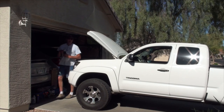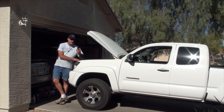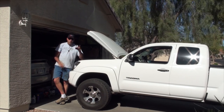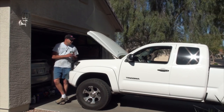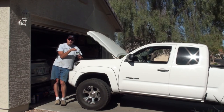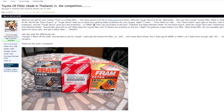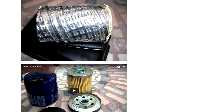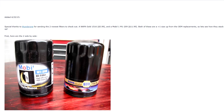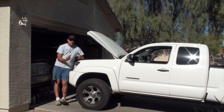I got the Mobil One filter. For the fan who wanted to see the oil change video, the three best oil filters for the Tacoma V6 engine are the factory YZZD31, the Napa Gold 1516 filter, and the Mobil One M1209. They are the best because they have the most filter material and the correct anti-drain-back valve to work with this system. There was an extensive test done on Tacoma World by a forum member who tore apart every single filter available, looking at filter material size, anti-drain-back valve quality, construction quality, and ease of disassembly. Toyota's is the best, Napa Gold has the second most filter material, and the Mobil One has the third most.